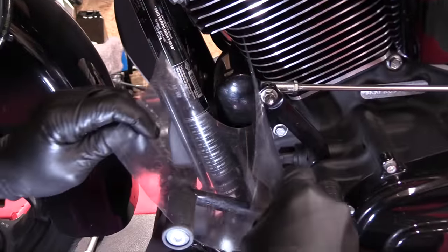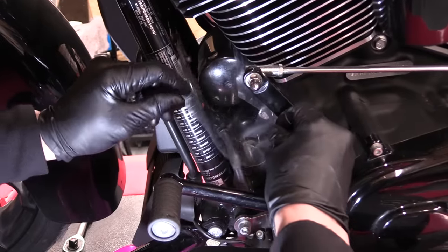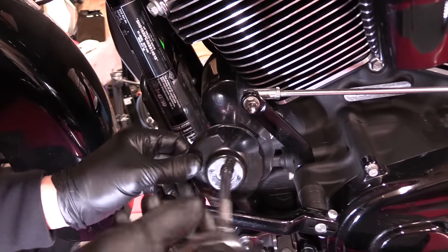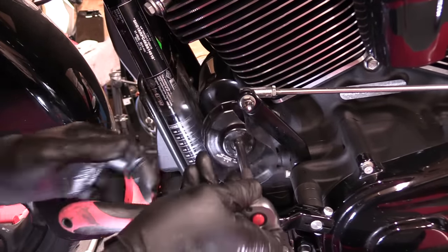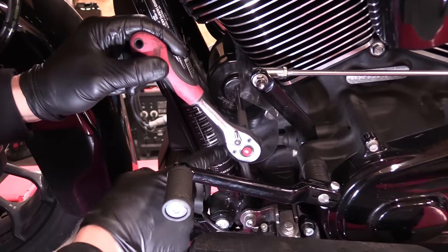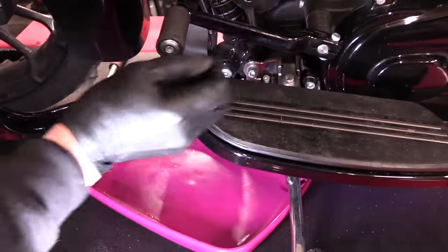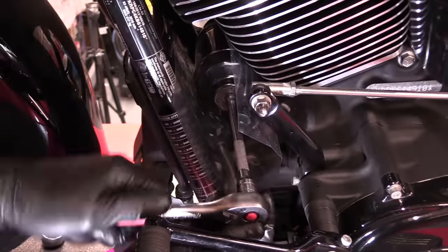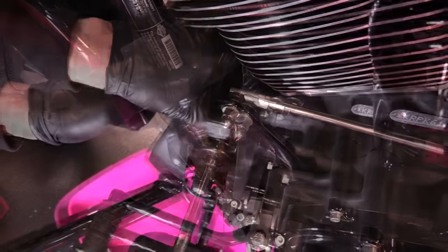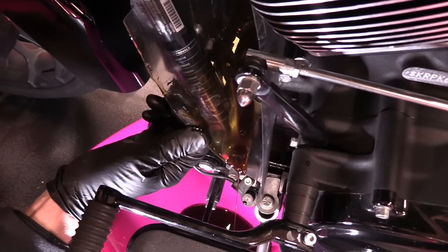Take your cellophane, curl it, pop it underneath the filter, and tuck it all the way up to the end. It forms a little track, so when you pop the tool onto the filter and it breaks free, the oil pours out, comes down the cellophane, drips out the end, and goes straight into your waiting jug underneath. It catches all the spillage — no mess on your engine.